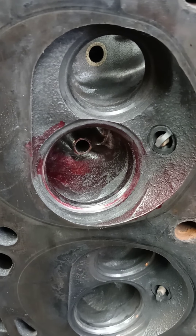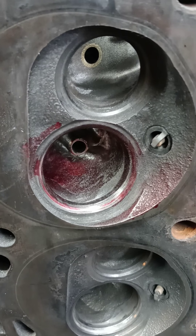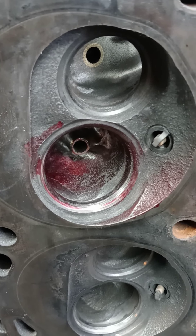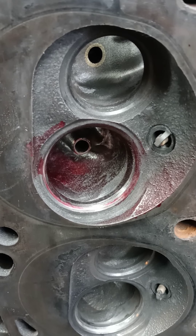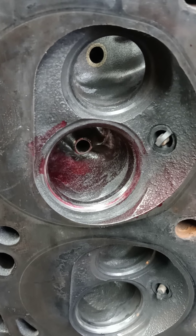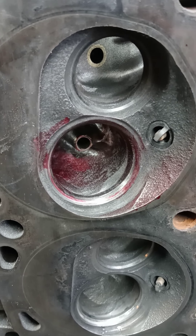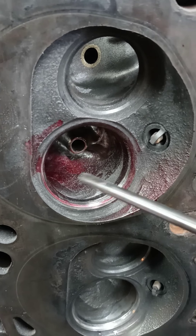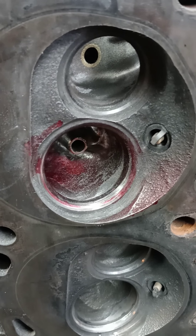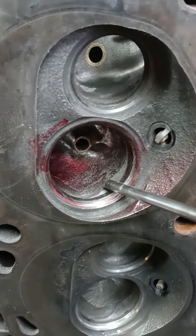Here's what made me think about going the route that I went: I thought about what heads work well. The best Ford head I ever saw — and you don't see them much — is the Tunnel Port head. There's not a lot out there on them unless you keep up on the old-type Ford performance. And when you see guys do heads up, if you look at anybody supporting and machining any kind of heads — Dart, World Products, AFRs — they don't have any of this in the bowl.